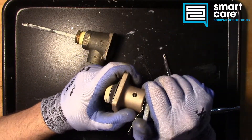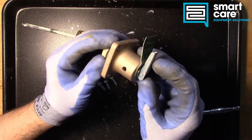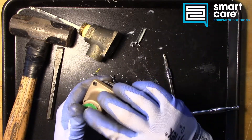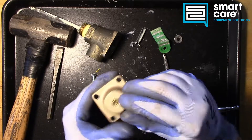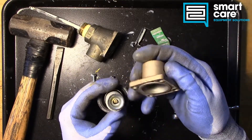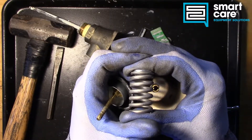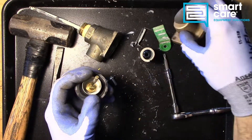To go further with it, it looks like we'll actually have to pop this rivet out to get the thermostat assembly out of this housing. We chiseled off the retainer and the small rivet that was in the end, and now we can open this up the rest of the way. First thing to notice is we've got an adjuster that was hidden underneath this washer — that's like a calibration screw to adjust the preset tension. Then we have this really heavy spring. It takes everything I've got to compress it even a little bit. I clamped it in a bench vise to take the spring pressure off the pin to get that rivet out.